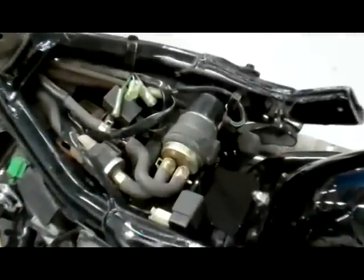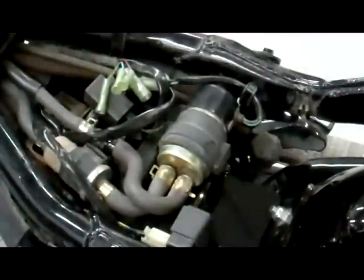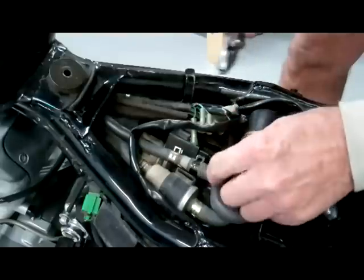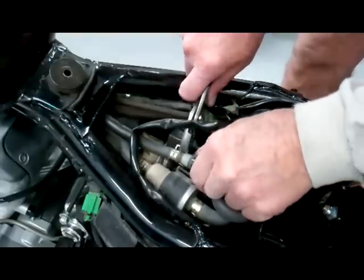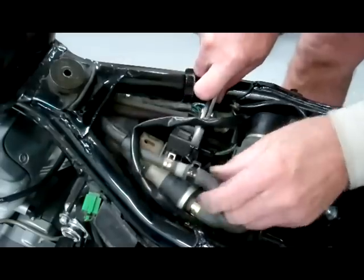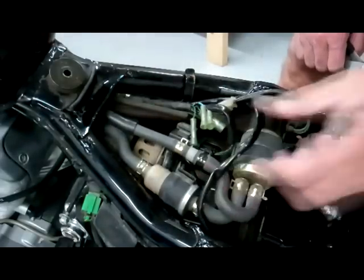What we're going to do is disconnect and pull these devices off the fuel pump, and then these three units right here. The first thing is to pull this fuel line out of this little keeper — grab that prong, pull it over, and pop it out of there. It's this little wire keeper here.